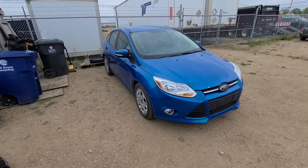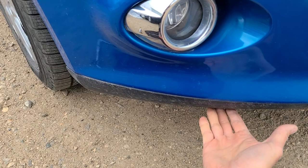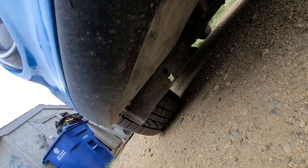This video applies to Ford Focuses made from late 2011 all the way up to 2018. The easiest way to access this light bulb is actually through the bottom by removing the splash shield, and then you can just pretty much squeeze your hand inside and replace the bulb.